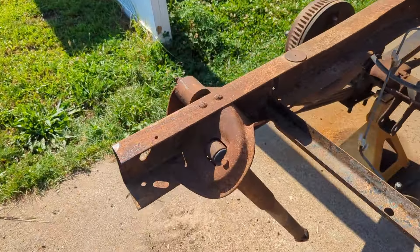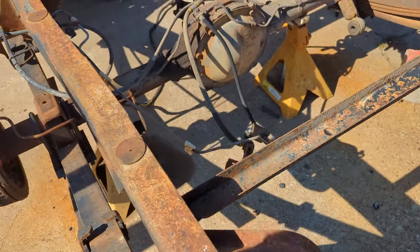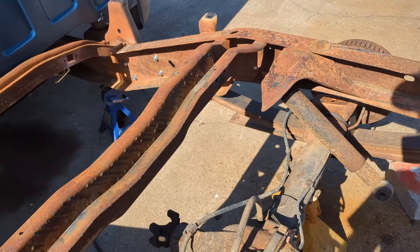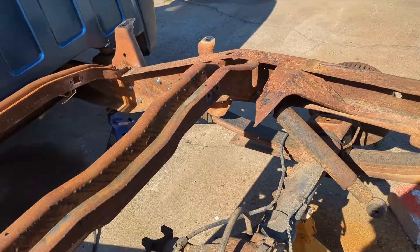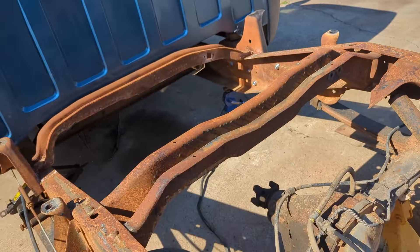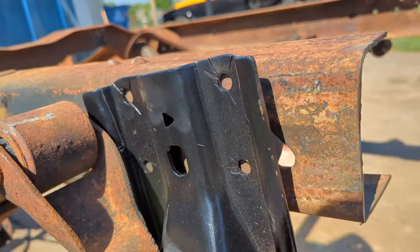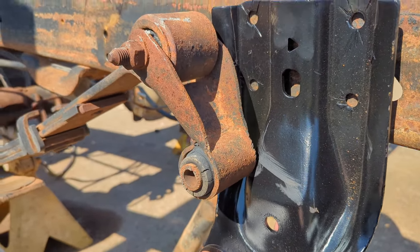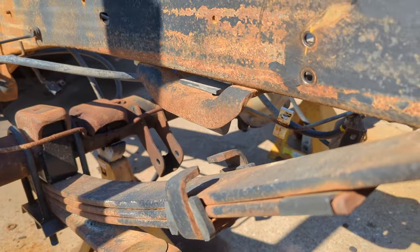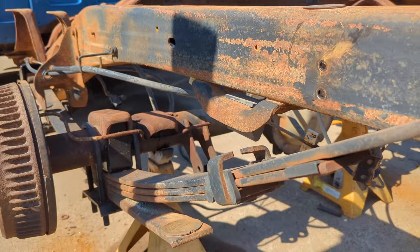I got the bed back off. Here's the shock tower — I got to move this up to here. That one I think I'm going to have to eliminate and build something different; I might be able to build something onto this, not 100% sure yet. I got to mount my rear spring hangers, drill some holes for those, bolt those on. Got to move the axle stop and another bump stop. Still got a lot of stuff to do — I got one side done.